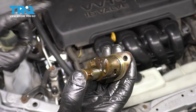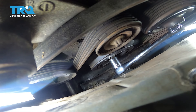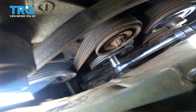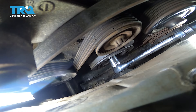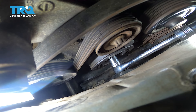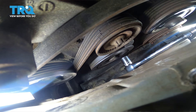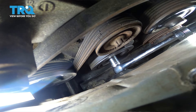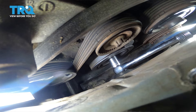You may not hear anything when this hook unhooks itself, but you will definitely hear the tensioner popping out and expanding. I'm going to attach my microphone to the back of the engine so you can actually hear it. Let's put our ratchet on the crank bolt and go counterclockwise. I heard a little click — I think that was the hook releasing. That was definitely the hook releasing. Let's go clockwise now and listen for that snapping noise of the tensioner releasing. That's it. That's all it took.